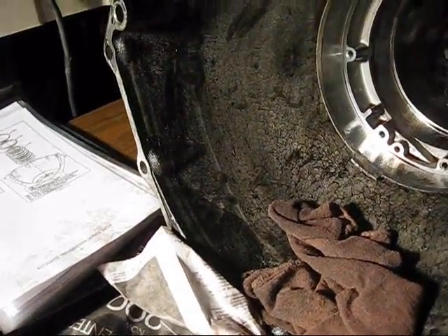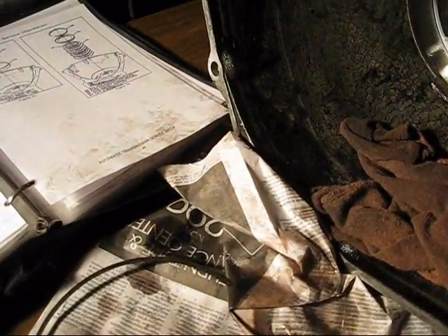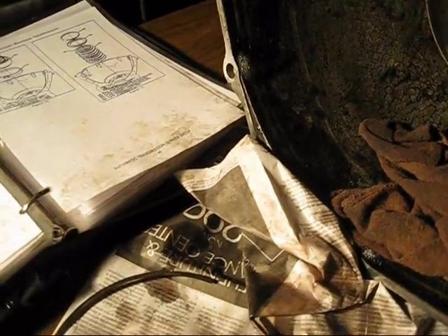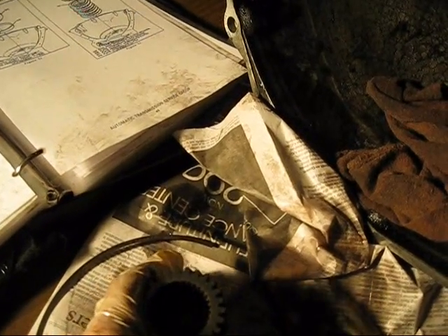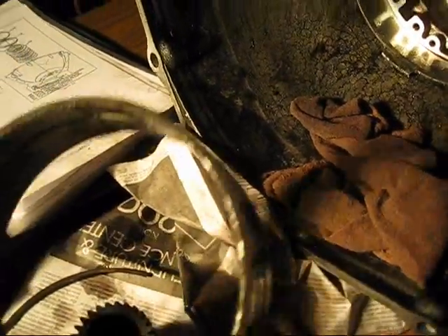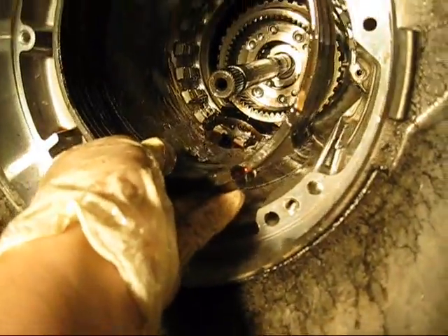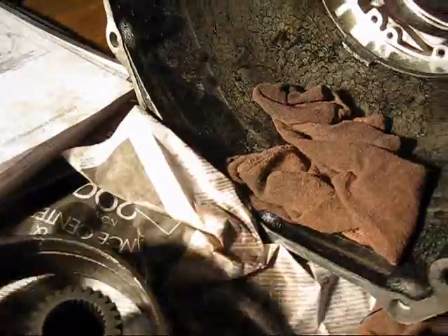In this portion, I removed what I thought was a snap ring, but they're calling it a thin spacer — 643 from the case. Then I removed the thrust washer, and then I removed this guy. Then I removed the band. The band was in there with this funky part down at the bottom, turned a little bit — that's exactly how it came out.